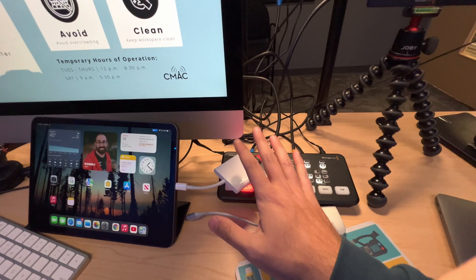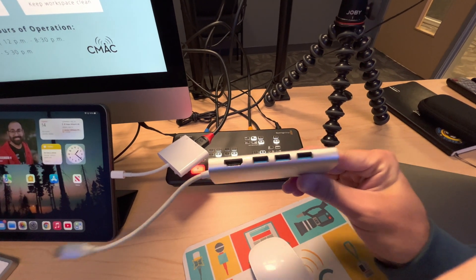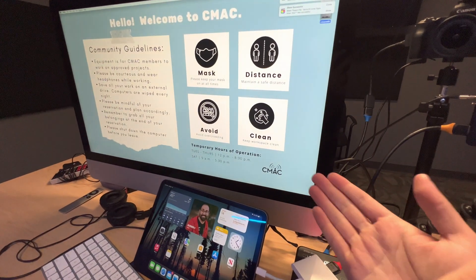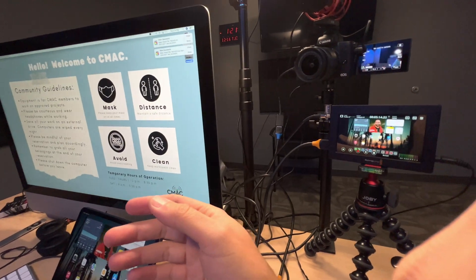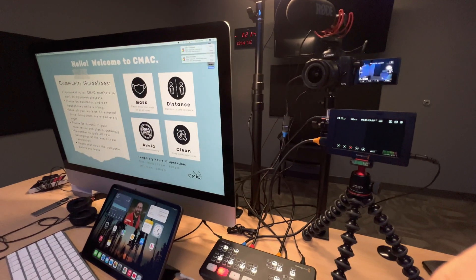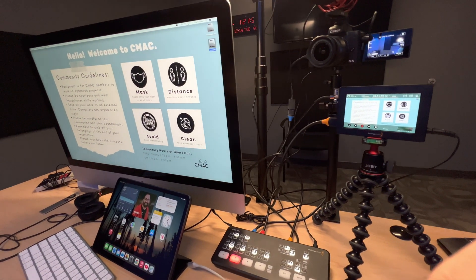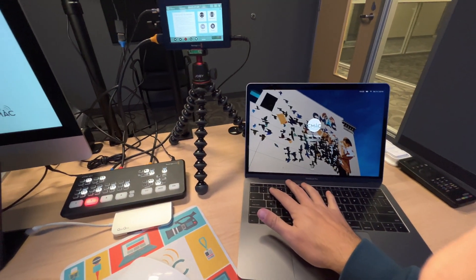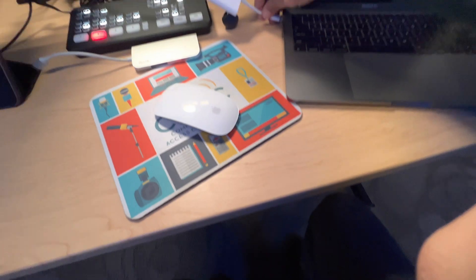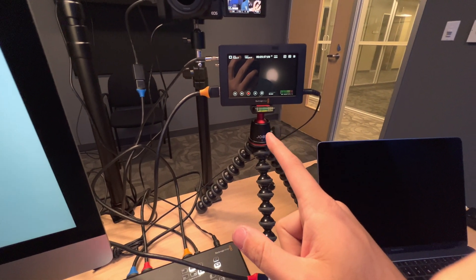I've used the VAVA, the IASU, and iCling adapters — they do not maintain HDMI out from an Apple Silicon chip or a Mac with a T2 chip, which is basically like an A14 running security and hardware graphics acceleration. But the Apple adapter plugged into this Mac — we're up and holding steady.